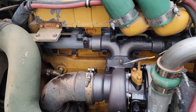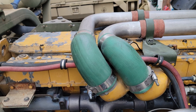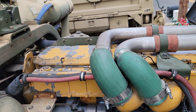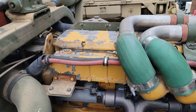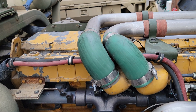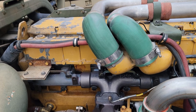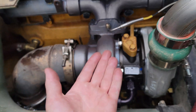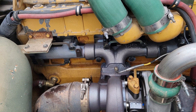The 4R9815 is kind of a bottleneck in this whole process, along with the original Gen 1 manifold. This Gen 2 manifold flows a lot better than the original one. One fear people have is that the valves aren't up to the task of handling more power, but referencing the motor home engines running past 300 horsepower from CAT would prove that to be an incorrect statement. If you have the 290-horsepower version and your original turbo goes out, this is a great drop-in replacement — same horsepower, and your EGTs are going to come down a little bit.